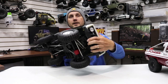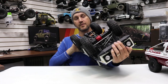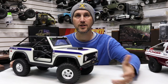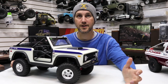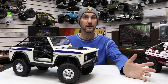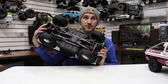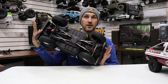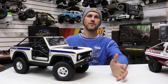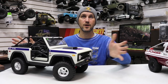I also love that it's got a straight axle with a far-offset front diff. It gives you a little extra clearance in the center, but more importantly it looks realistic — none of that centered front axle setup that nobody actually has on their real truck, because everyone has an offset front output shaft on their transfer case to get around the transmission. I'm so happy Axial finally put that right on the market.